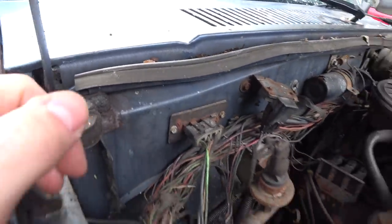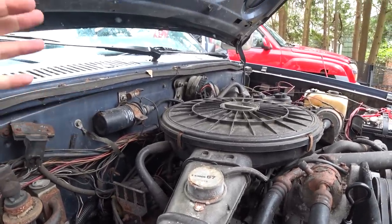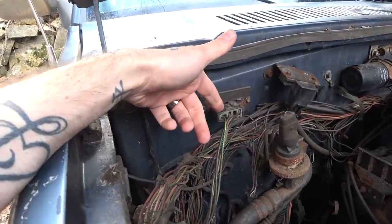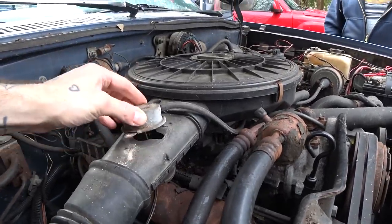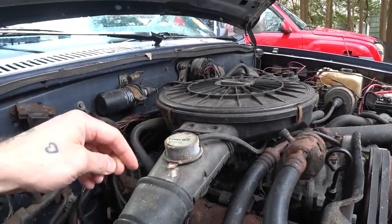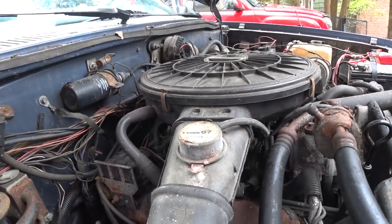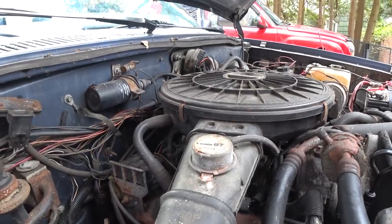Here's why the throttle body injection thing is just a mess - it's not that it was a swing and a miss, it was a necessary step, but the reason I'm talking about just getting rid of it for carburetion: I know some of you old heads have heard me say that and they're like 'you clearly have never had to deal with carburetion on a cold January morning.' But this stuff is such a barrel of monkeys - there's weird injectors, sensors, some of it's vacuum actuated. What is this? I don't know what this is. It probably controls some type of air-fuel ratio. It's vacuum driven but it's connected... it almost seems like this would be some sort of vacuum advance but for throttle body injection, but I don't know enough about it. These were only made for a few years, everybody hated them, so there's not a lot of guys that know about them.